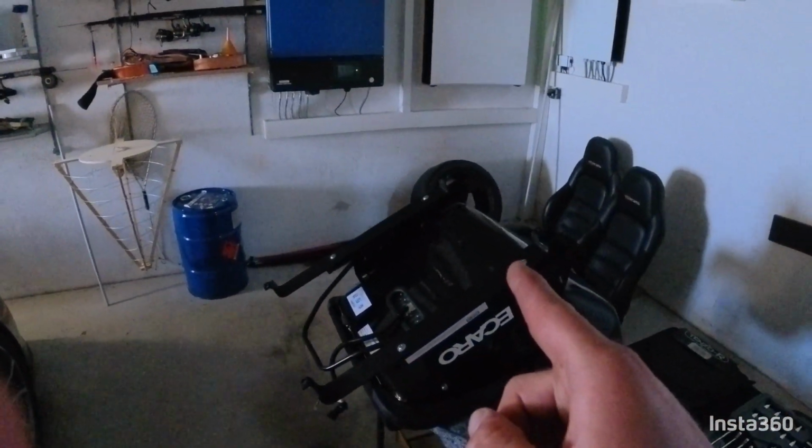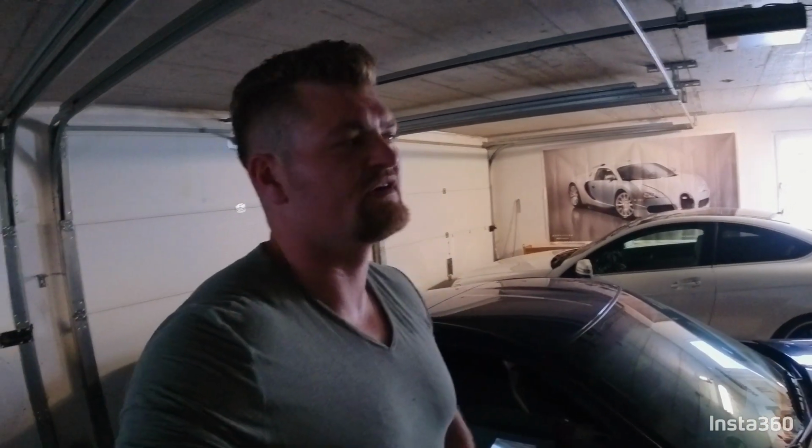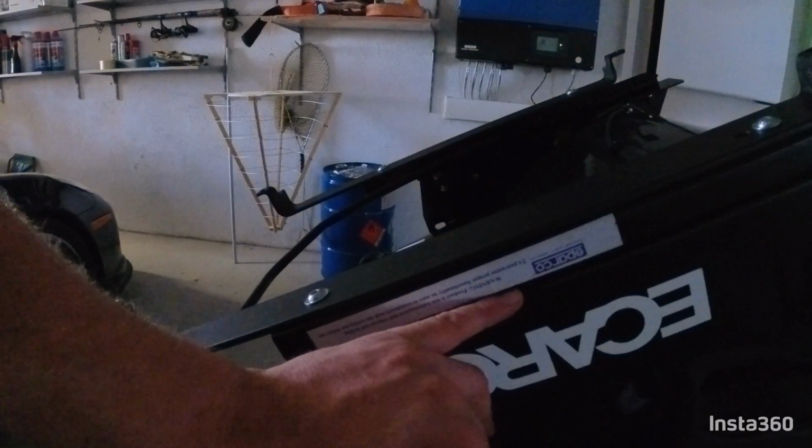The nice thing about setting it up like this is that you sit relatively low in the car. Pretty often when you install seats on the C6, you hear that the issue is that you sit way too high. Doing it like this, I think it moves you down pretty much as far as possible. The only thing that adds height is the height of this sliding bar, the Sparco adapter here. The bar sits pretty much flush with the carpet, and all in all it's relatively simple, but it works.